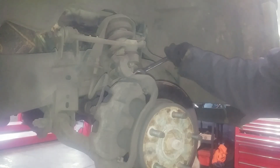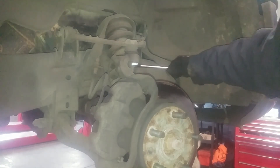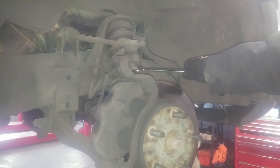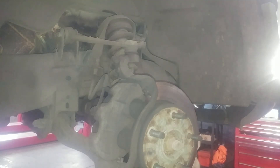So that is the close-up of what we're doing to remove this. The ball joint is wedged in there, the shaft is wedged in there. We can probably turn this off, and maybe we'll use some lubricant on here too. The ball joint stud probably won't turn taking it off — just need to hold that while we're putting a new one back on.